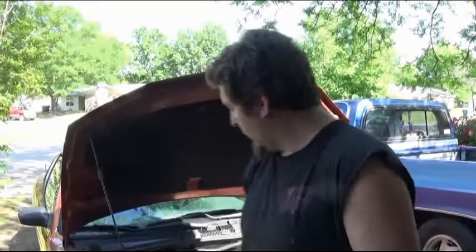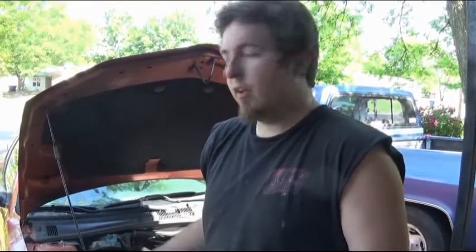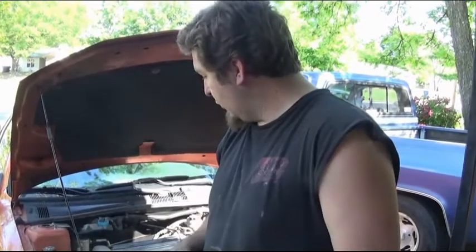Alright, now once we get all three of the bolts tightened up, we can get the belt put back on, and then we can go ahead and lower the jack that's holding the tensioner. Make sure you got the belt lined up. It'll put the tension back on the belt. You'll be done there. Move that jack. Then you can lower the jack holding the car up so you can get underneath it. And then you should be good to go once everything's all hooked up and connected.